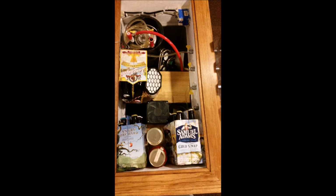You'll notice I did put a couple shelves, so to speak, on there. They actually sit on the lip of the freezer itself. They're just some laminated floor that I cut into 16 or 16.5 inch lengths, and they fit real nice, slide back and forth. And then in between the 2 laminated shelves, you can see the fan sitting there. And I also put a moisture absorber thing that I got at the dollar store to try and keep the moisture down.